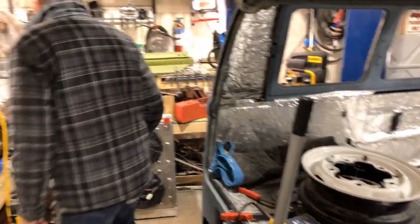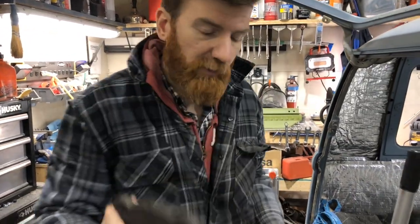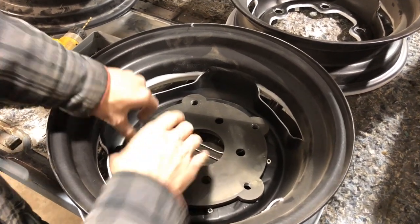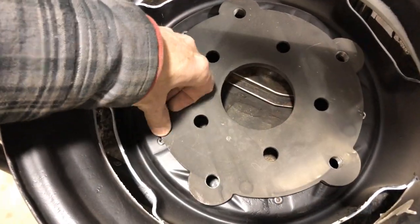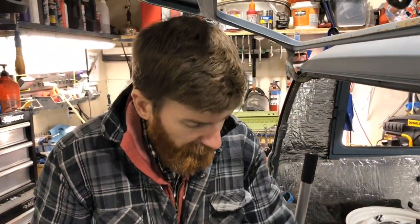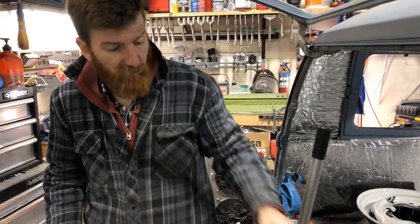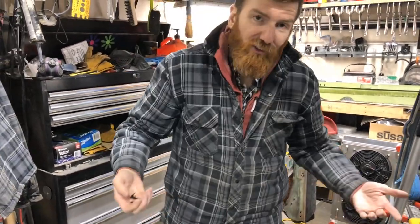The way we're mounting with the adapter plates — because we've switched to the 944 braking system — we're even better off, because our plates have tons of clearance with the rivets. I don't know if the camera's picking it up, but there's lots of space there; we're not touching. So we have no issues. Obviously, if you're mounting on a stock rim, check to make sure that's flat. I'll go ahead and notch and drill out and show you using a rivet.